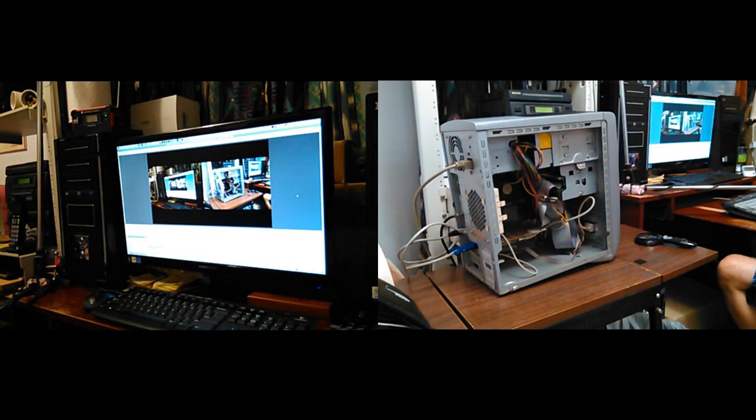It's pretty loud, but it spins really freely. I took the little shroud that directs the air around to the, right up in there. Oh, I guess you probably can't see my mouse. Okay, because I'm not doing desktop anyway, up around this, there's a shroud. You can probably see that it's not there. It was a big old beige-ish white thing, but it is the CPU fan that's making all that noise.